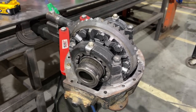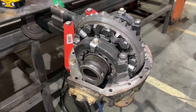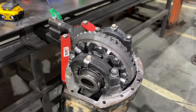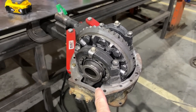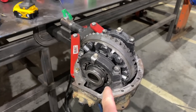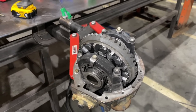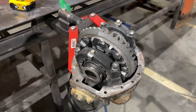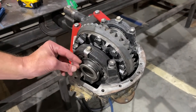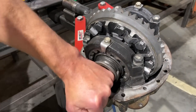The reason why they tell you that — when you hook up the motor, if it's wrong, all your lights will be flashing, and then you'll call my sales guys and ask them why your diff doesn't work, and that's why. When I pulled my rear third member, I did read the factory service manual. I put it in four low and locked it because I didn't want to take off the actuator. I rolled back and forth on my driveway, got it to lock, and then I lifted it up and pulled it. So when you get the diff back, you want it engaged all the way towards the center.